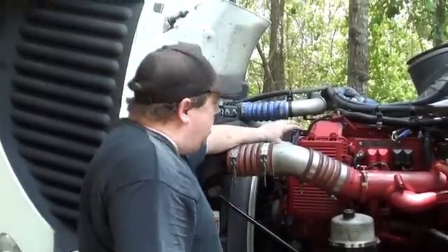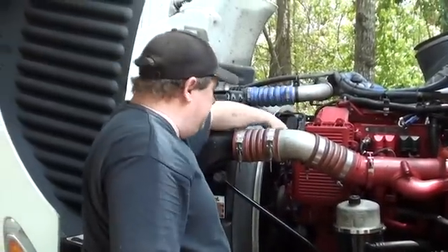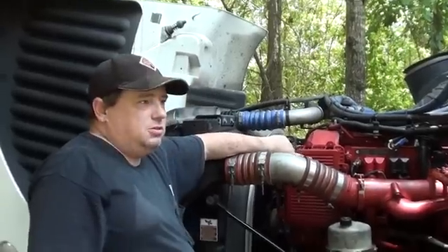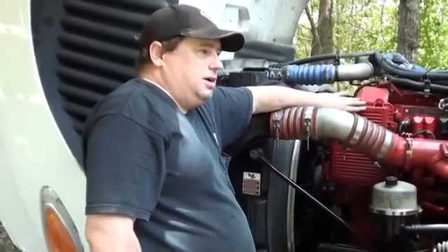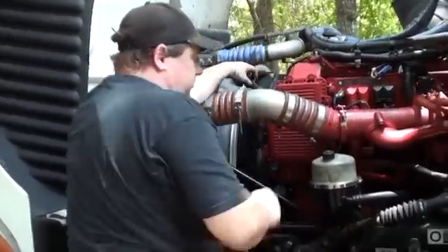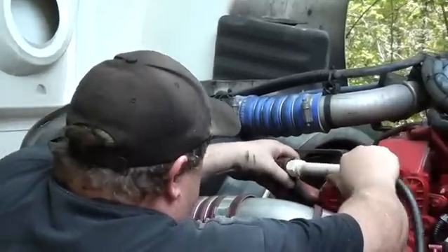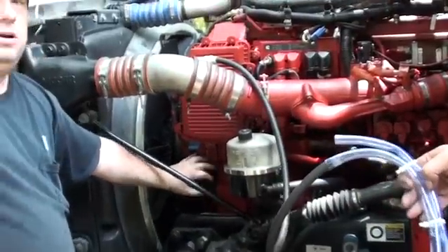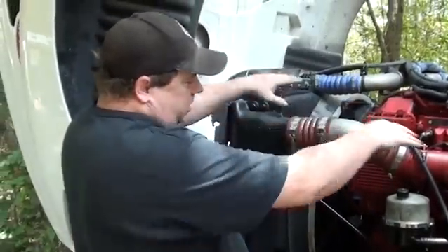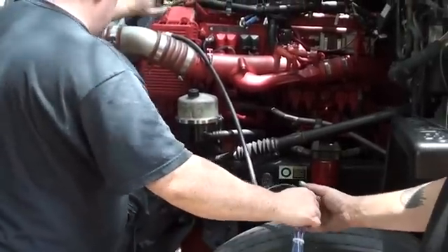I don't like to use the oil fill tube as my test point because you don't know what condition the crankcase filter is in — that introduces variance. So I figure we pull it off before the crankcase filter and use this adapter in place of the crankcase filter, taking it completely out of the equation. We clamp the adapter on there and leave the oil filler cap on the fill tube, so there's still a consistent relief point without worrying about crankcase filter differences.